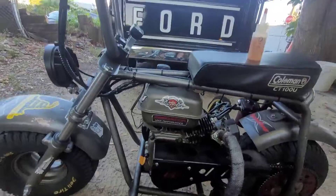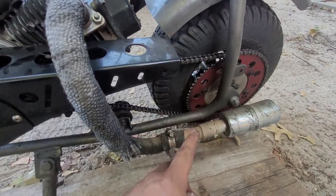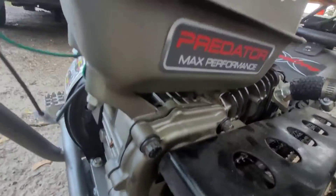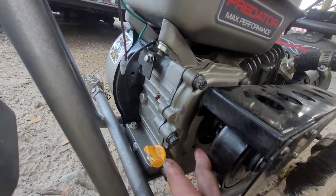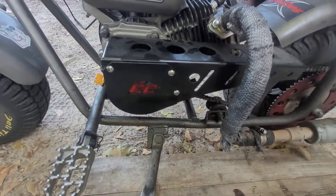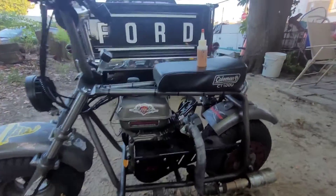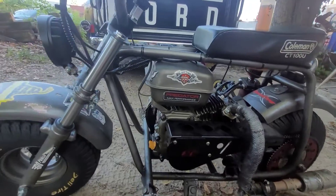It's all back together. I boosted the motor up and moved it forward more — that'll tighten it up a little bit. Bar and chain oil — that's what I use on my chains, because if it's good enough for a chainsaw it's good enough for a mini bike. I took this all apart, cleaned it up, scuffed it quick with a piece of 100-grit sandpaper to get some of them hills and valleys out of there. Bushing inside looks good, cleaned that up, greased it — not too much, so you don't get it all over the clutch shoes and start slipping again.